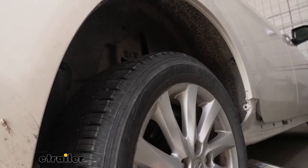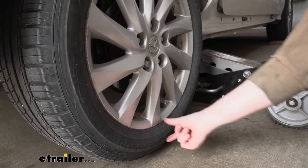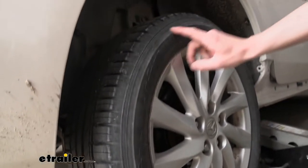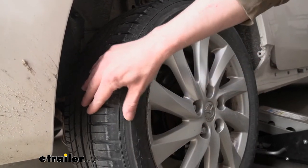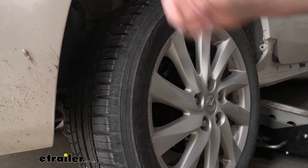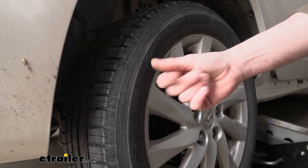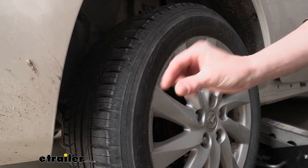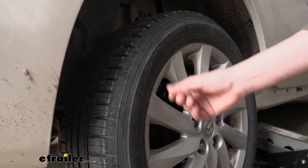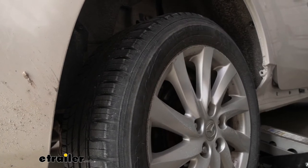When you deflate your tire and drive on it, your sidewall is not extended out like you see it. It actually squishes — every time it gets down to the bottom of the tire where the weight's on it, the tire squishes out when it's low on air. That constant squishing and movement wears out the sidewall. You can actually feel there's a physical groove in this because material has been removed, and it's the same on the inside of the tire. There are little black balls inside — rubber material worn off from flexing.